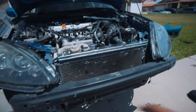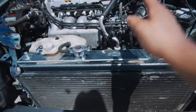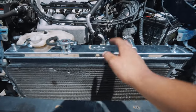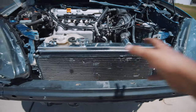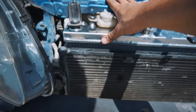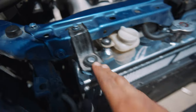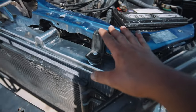This is more of a maintenance type of mod. Although, if you're going to modify your RSX or any vehicle, I always recommend upgrading to an aluminum radiator just because — plus they look shiny and cool. Stuff like this does add value over generic replacements or OEM ones. These little brackets are a little bit tricky. All you have to do is push the radiator forward as much as you can while you thread it down. Once I pushed the radiator forward, I was able to attach everything.